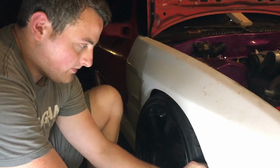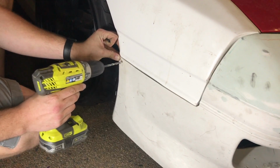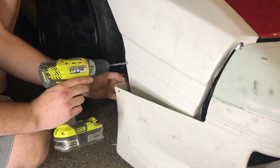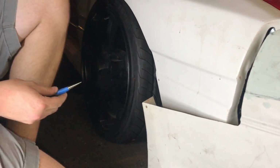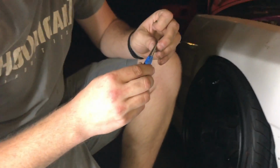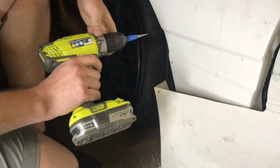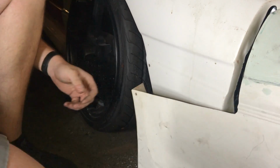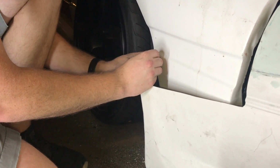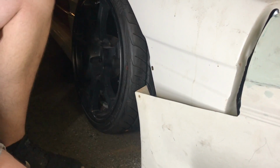So once I line this bumper up, I made a hole in the bumper, and then I'm going to start a hole in the fender. Pull this out of the way. So you drill this hole for the fastener, and then this hole to size of the rivnut, which in my case is about 11/32, so I marked the step drill so I don't go too far. So this rivnut should... Ooh! So that should do it.